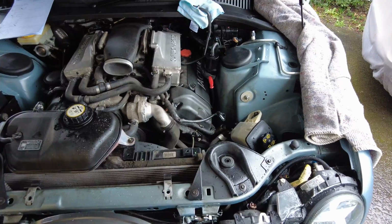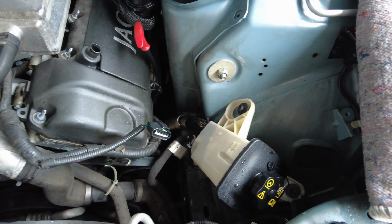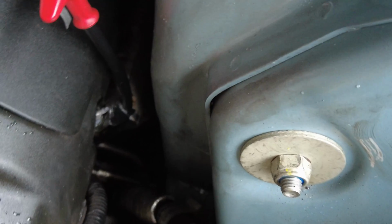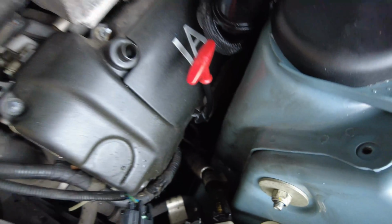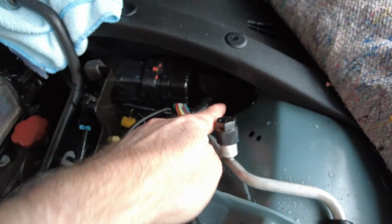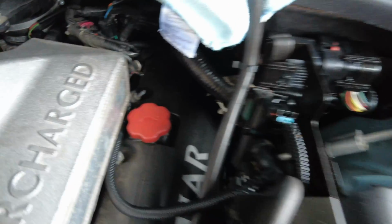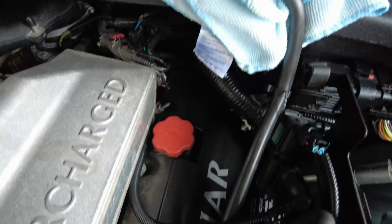So a quick recap as to where we are. Well, it's still raining, not great, but we've managed to release the power steering reservoir. The dipstick, in the end, I needed to cut a line there with a hacksaw. I can now get access to the bolt, which is good news. Up over here, I've removed the 2 bolts there just to give a little bit more room. Not a huge amount of room around there, to be honest. I still think I may struggle to get access to the bolt at the rear, but we'll give it a go.